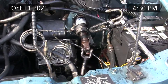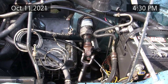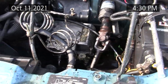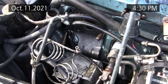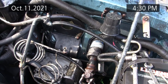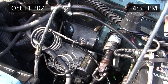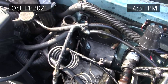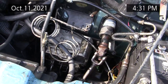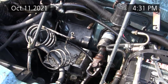I'm trying to fix the brakes on this van — they went out. I need to get this vehicle back into service immediately. I decided, since I'm in this deep, to replace the Hydro Boost — not Turbo Boost, Hydro Boost — that was leaking and caused the failure. I lost all of my power steering fluid from the Hydro Boost leak. I've ordered a remanufactured unit from Napa, and it'll be in a few days.